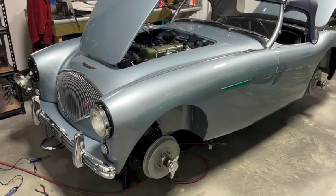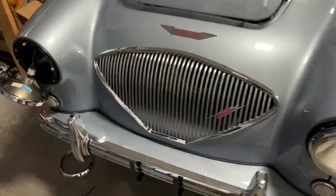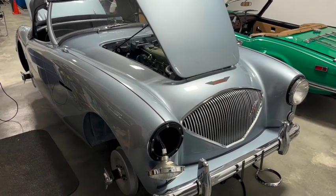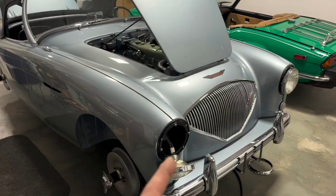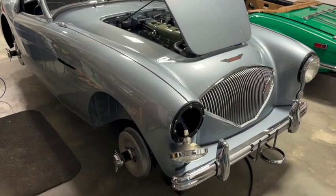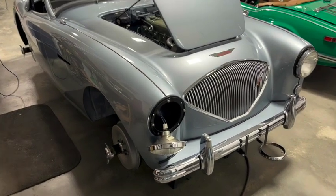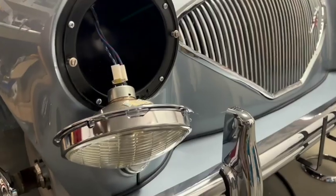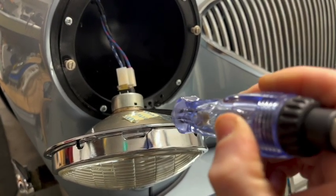I've been resolving some minor electrical issues with the lighting on my car, specifically the headlights. They weren't working at all for the longest time and I determined it was the actual switch on the dash - if I jumpered the two terminals, suddenly they worked. But they only worked on one setting, and if I tried to dim them with the dip switch they'd just shut off completely. I replaced the dip switch and it turned out that wasn't the switch at all - using an ohm meter confirmed the switch works. Using a test light, I found it was actually the plug into the back of the light.